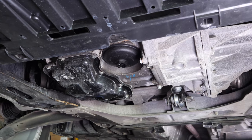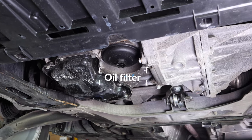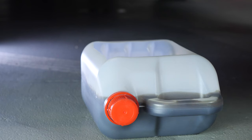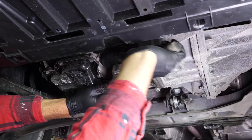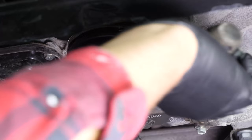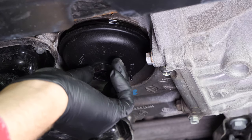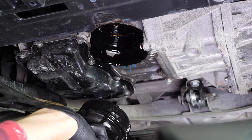When you change the oil in your car, you must also replace the oil filter. Access to the oil filter is done from underneath the engine compartment. To avoid letting the oil inside the filter from flowing out, place a collector for liquids under it. With a socket wrench and a 27mm socket, loosen the oil filter by turning the wrench anticlockwise until it begins to turn easily. Finish unscrewing by hand. When it has been released, turn it upwards to reduce oil spillage.